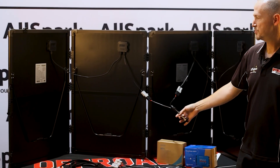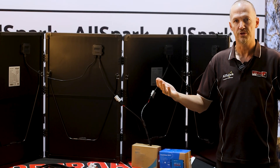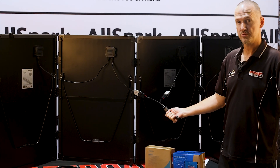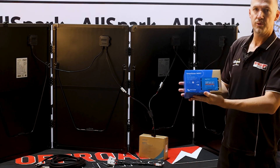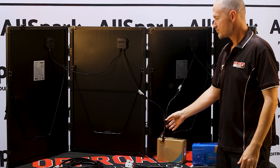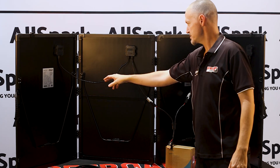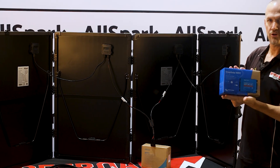That gives you lots of flexibility depending on the style of controller you have in your four wheel drive. If you're using a DC-DC charger, most of them are only up to around 32 volts, so you would run with the parallel connections at 20 volts. If you have an Enerdrive DC-DC, for example, where they can take a higher voltage input, you might want to use the series double adapter. Or if you have Victron solar controllers — the Smart Solar — which can take up to 100 volts, you can run this system in series using this adapter. Or you can use our higher voltage model, which is exactly the same arrangement except instead of parallel connections, we have them connected in series, and you can run at 86 volts into a high voltage controller.